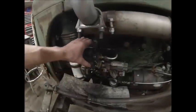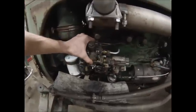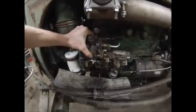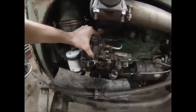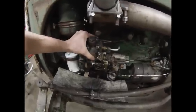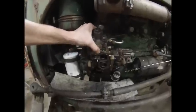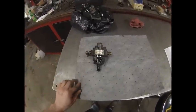There's also a plug in this hole that has to come out — it's used to direct lube oil into the head drive. Once you do all that, according to the book you just lift this guy out. This is the first time I've ever done this, so we'll find out. Two hands would be really nice here — but just like that you get your hydraulic head off the pump.